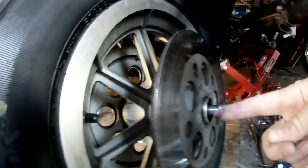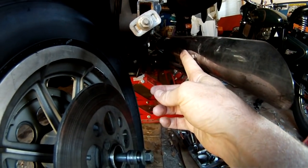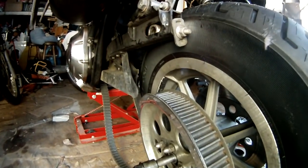It's possible that if the nut came off the other end and it started working its way loose, it would hit the muffler and your wheel wouldn't fall all the way off. Whereas if there was nothing to stop it on this end, it might work its way all the way out and your wheel would fall off.